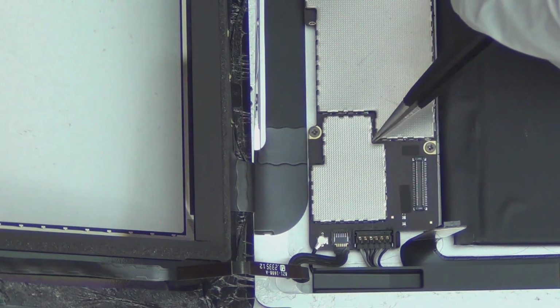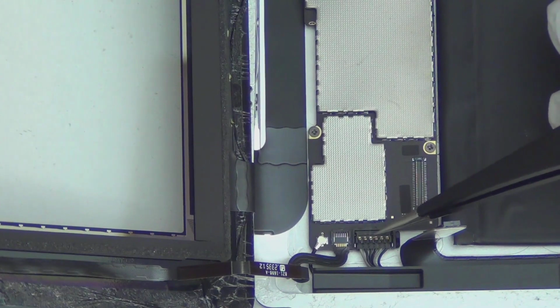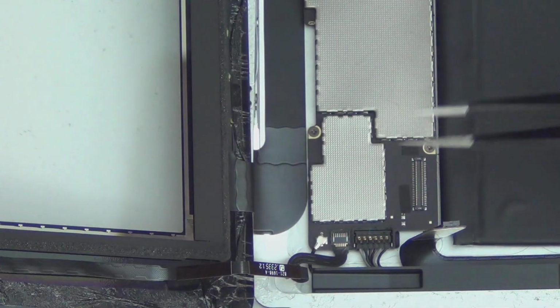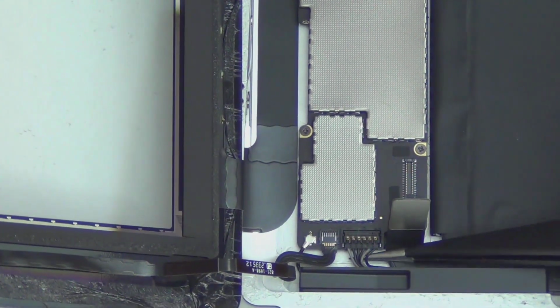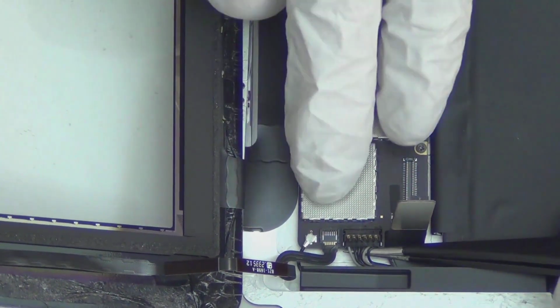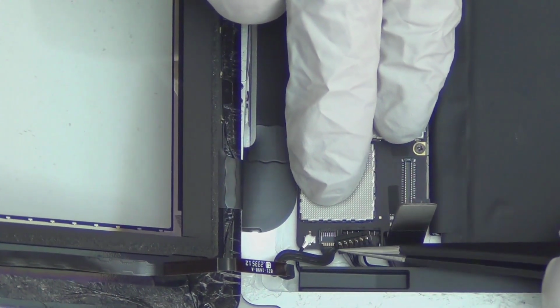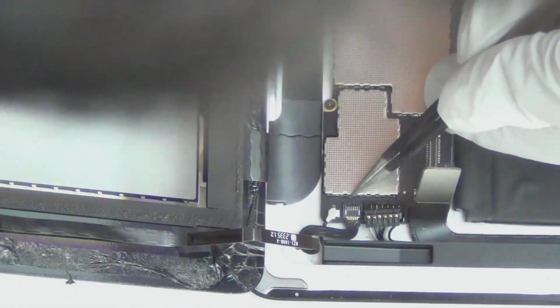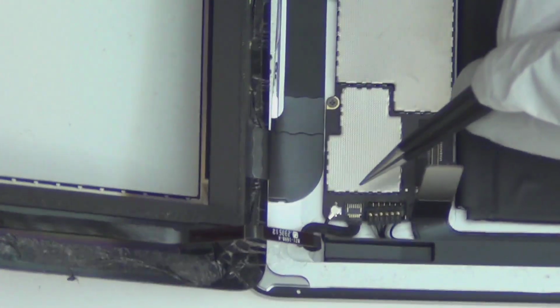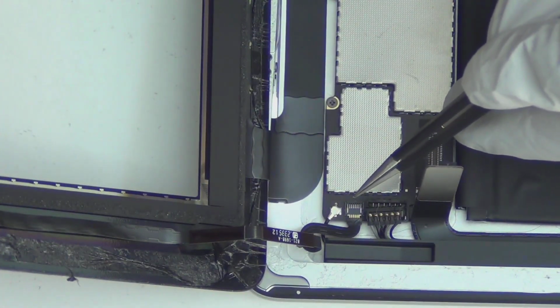connector of its type. Its mechanism goes upward, so you want to get the connector up. What I do is put my tweezer in, or a plunger, something underneath, and lift it upward, not on the side. That's it. Done. Easy. And this is a really low flat cable connector. I feel a little bit better about this connector, even though it seems to be a similar design to the other one, but I think this is more sturdy looking.